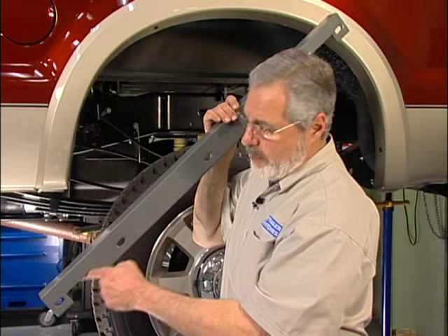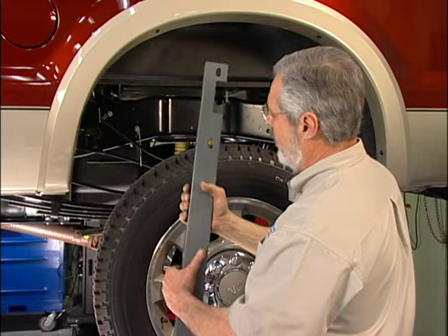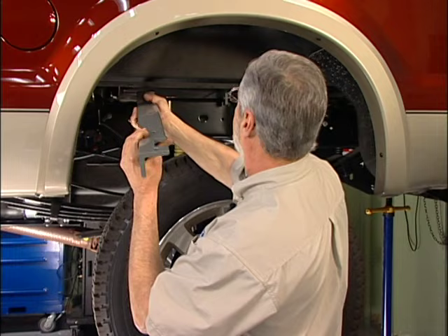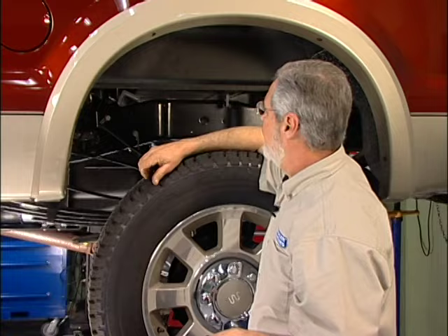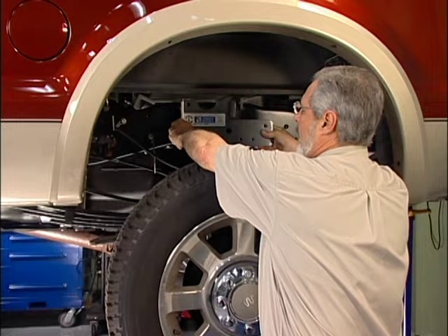Read the instructions, but always test. When you look at these cross-members, there are two different ones. This one has two notches, one on each end. The one that goes in the back has three notches — that's how you identify it. You can see this flange faces forward with the oval-shaped holes. When it's in there, it's going to roll and face our side mount. We slide this in, go over our shock absorber — didn't have to notch. I'll roll this in place and position them following the instructions. The next thing we'll do is put our side mounts in.